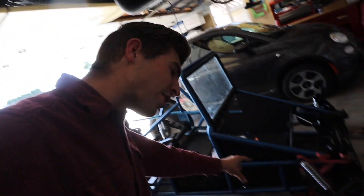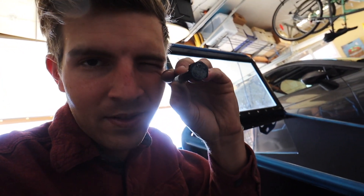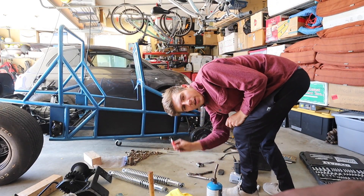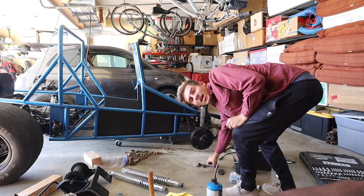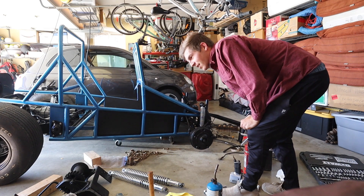Welcome to another day in the vlog. We're just finishing up putting in our last suspension piece. Long story short, we accidentally stripped it last night, so I got a tap and die kit, tapped that out, and got a new bolt. I also imprinted my thumb on the top of that screw as a signature. We used thread locker red on that to prevent it from coming loose since we did tap it. Next, we're going to lift the front end and put some tires on.